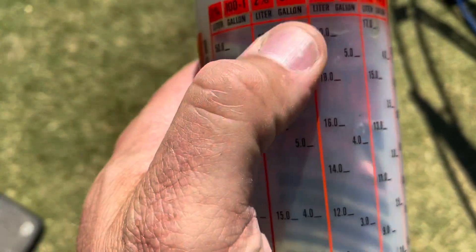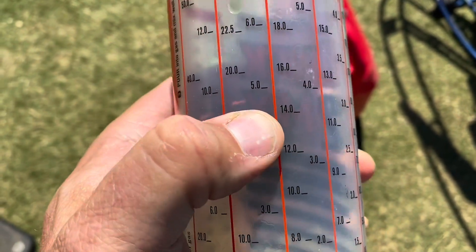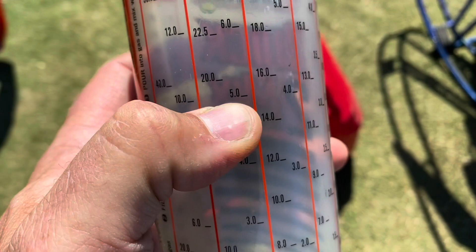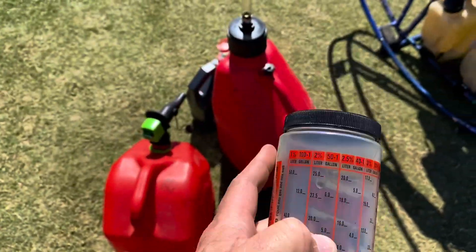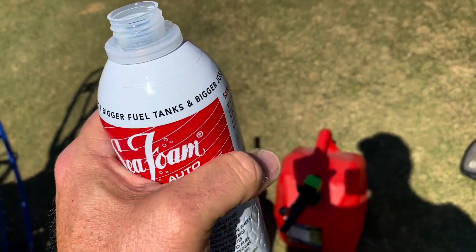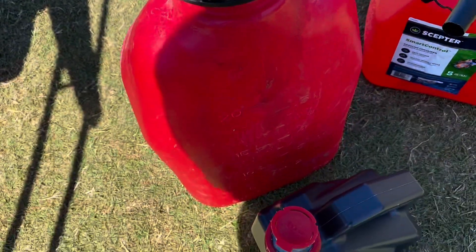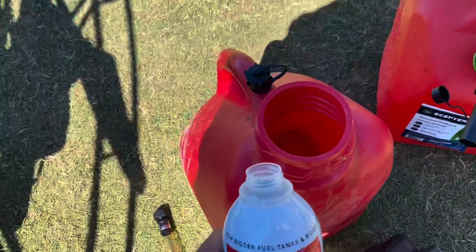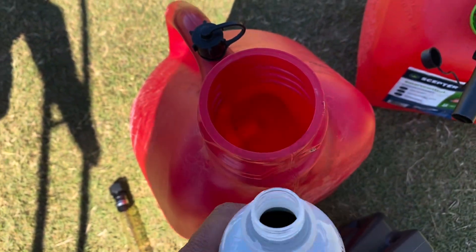I scroll down and there's 6 gallons and there's 5 gallons. So I want to fill up my two-stroke oil up to this mark and then put it in here with 5 gallons. I've been putting a little bit of seafoam into my jug and I have had less carbon buildup — not a whole bunch — per 5 gallons. And that's about all I do.